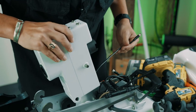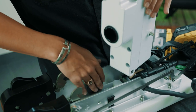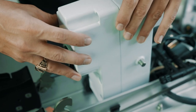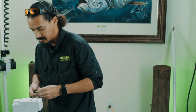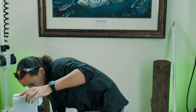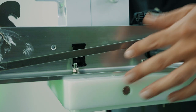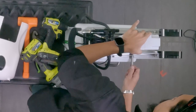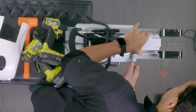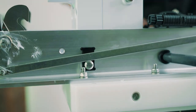Take your new steering box and put it right back in. Now's a good chance to get in here and clean out any corrosion. Make sure the box fits nice and flush. Take your pin — you'll notice the pin slides right through there. Just make sure it's lined up, move the box around a little bit, and you'll feel when you can slide it in. Slide it in.